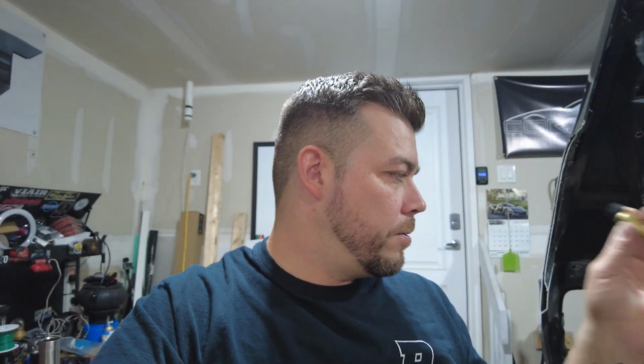This new one that they offer on Rock Auto is, I guess, an upgrade to that. So there's 2 pins within. I don't know if you can see that, but there's 2 pins within here and 2 wires that come out. One of these does not go to ground. So I don't know what this is going to do, so we're going to try it. I'm going to put the polarity different ways. We're going to heat it with a heat gun, watch the gauge at the same time, and try and figure out why this coolant sensor is not reading on the dashboard.